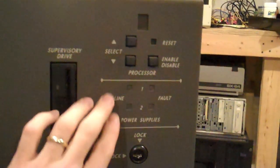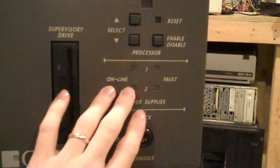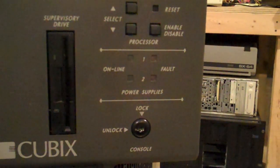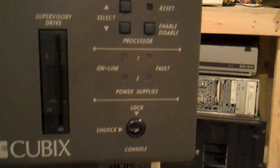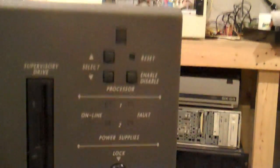The difference between the ERS and the ERSFT was the FT came with more than one power supply. Unfortunately one of mine has always been bad, but one is good. There are 375 watt AT power supplies in a nice canister style, so they're easily hot-swappable, and lock so that you can disable the multiplexer.